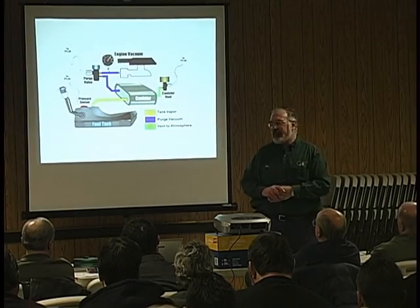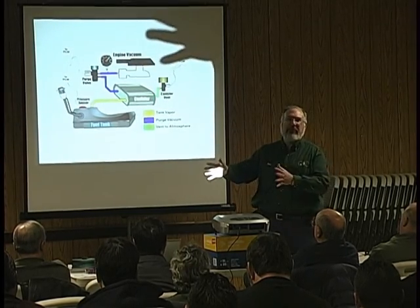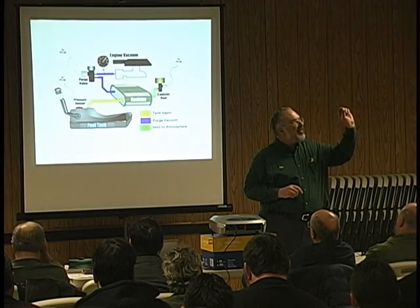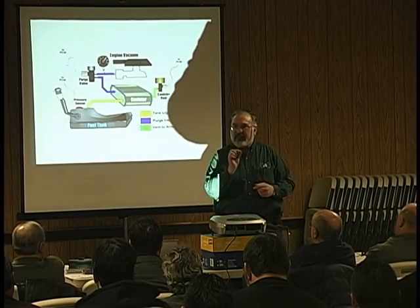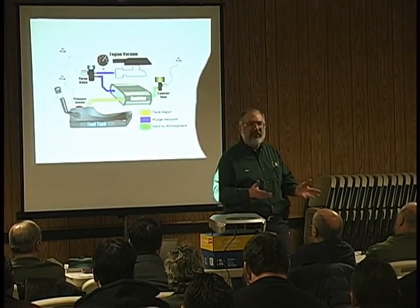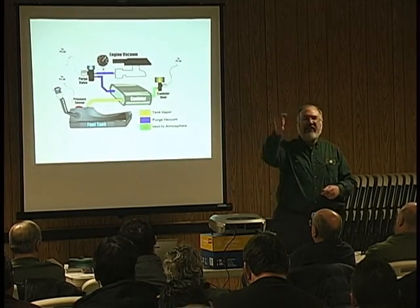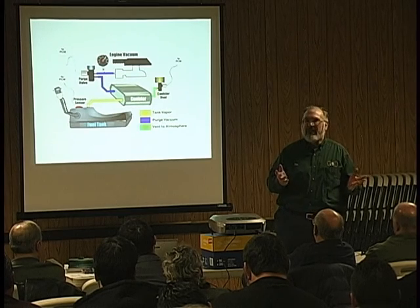But just another interesting sideline on that old '85 Chevy Impala, after I got the drain plug, since the mechanic was ruining my laptop, I went over to the vehicle just to make sure the threads were good in the oil pan. And I looked at the oil pan drain plug, and the thread was real fine, not real coarse like a 1.75, but real fine. I said, oh, there's something wrong. So I called up the Chevy garage. I said, what oil drain plug is supposed to fit in this thing? He says, 12 millimeter by 1.75. So I get out the old tap and die set, get out the gauge, and I measure it. It has half by 20 English threads in this thing.